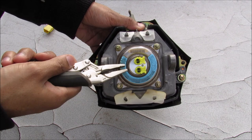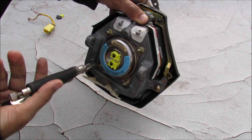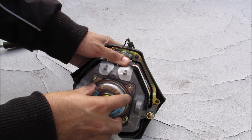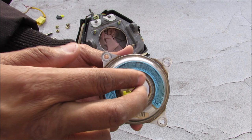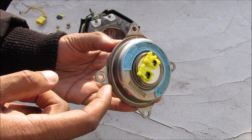The next thing I'm going to do is remove the airbag inflator from the airbag assembly. There are four tamper-proof nuts here — I'm just going to use a vice grip to wind these out. There's a special tool you can use to get these off, but a vice grip works. You can then remove the airbag inflator from the assembly by carefully lifting it off the studs. This airbag inflator is pretty much like a bomb — when you apply a charge it explodes the sodium azide inside, which produces nitrogen gas very rapidly and it escapes through these holes to fill the airbag.